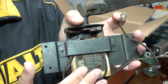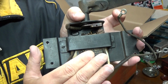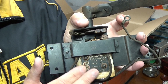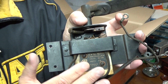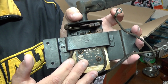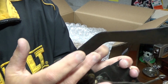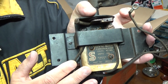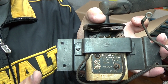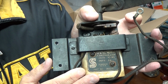When you're sewing at a slower rate of speed, the electricity coming into the foot controller is the same, but it's being held back from being released from the foot controller into the motor. And so that electricity being held in reserve will tend to superheat the foot controller. Particularly in an assembly like this, where it's mounted to the table and all you're having contact with is this, you're not going to probably notice that foot controller is starting to superheat. And it could cause problems. It could either fail, or in extreme cases, it could get so hot that it could actually catch fire.